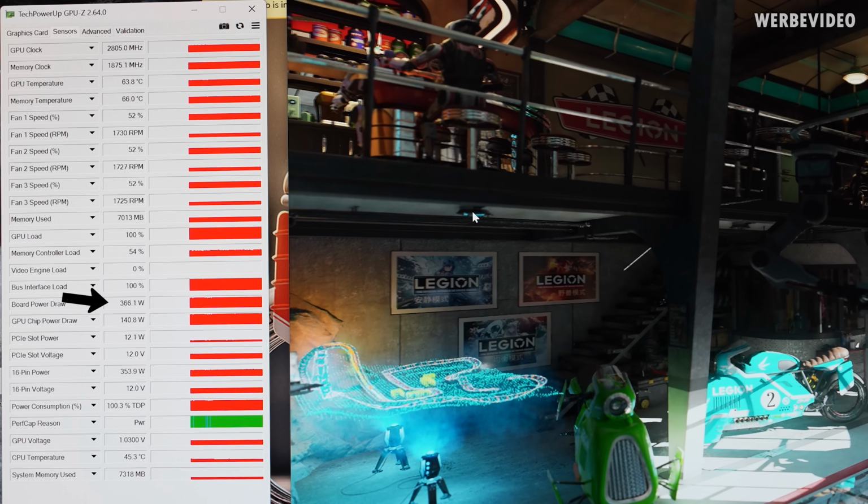Power consumption, nothing changed. But as you could see, the graphics card driver was reinstalled, which also confirms that this is not just a simple button, but it's actually a BIOS switch. So the same as what you have on an MSI card or like on an ASUS card with the Q mode, it is just switching to a different BIOS.